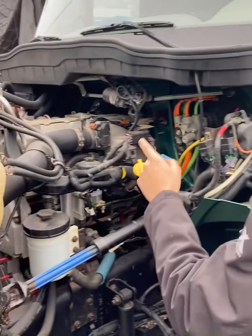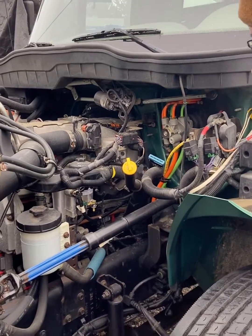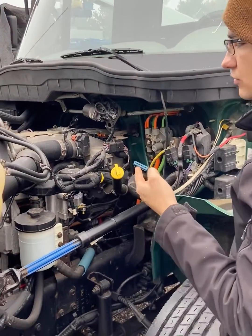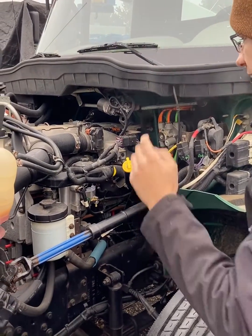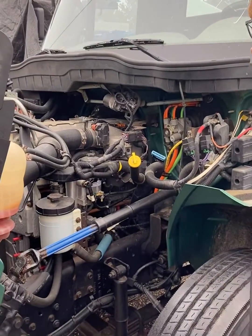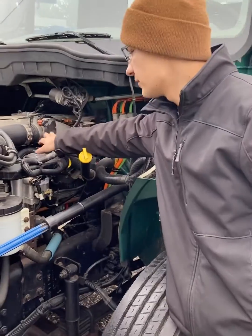So the other two methods of flow are, we're going to have one fuel line going to our DSI, which is our downstream injection unit, and that will flow at 50 psi down to our hydrocarbon injector, which is buried on the other side of the engine. It's just downstream from the turbocharger.